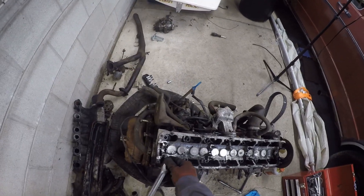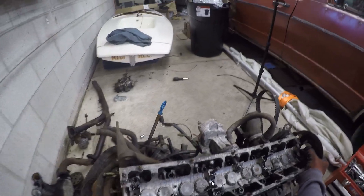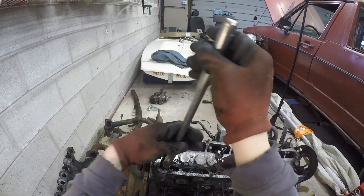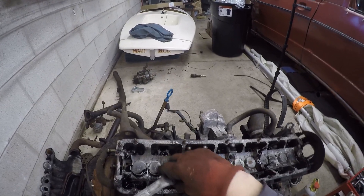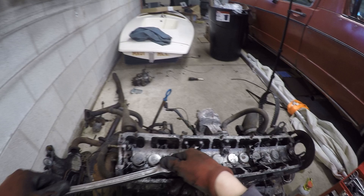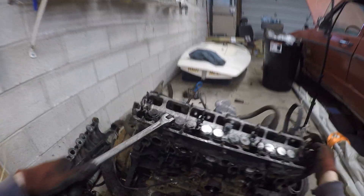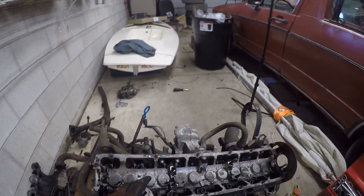Now it's time to actually take all the head bolts out — you're gonna need a special tool for this. This is an M12 triple square. It's something that Volkswagen and Mercedes are absolutely in love with; you'll have to get yourself some specialty tools for it, and these are really on there. I really wish I had turned on the phone camera on the tripod so you'd be able to see me writhing around on the ground trying to turn this breaker bar into a rowing machine. Remember to use your strong muscles like your legs. I'm not working on this on an engine stand because the engine is stuck — I wasn't able to get the torque converter off, so there's just a giant torque converter on the back and I can't put it on an engine stand.